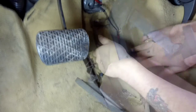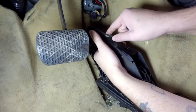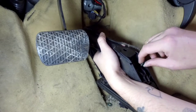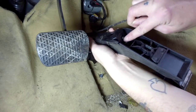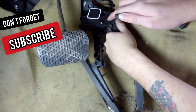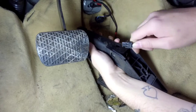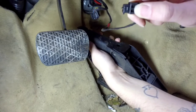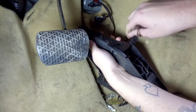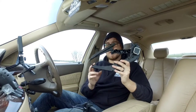You don't want to pull the pedal too hard because you've got this wire for the kickdown switch that comes along here and plugs into the bottom of the pedal. Just flip the pedal over once you've undone it, then unclip this wire - undo the clip, it's just a simple squeeze and pull deal. And then voila.